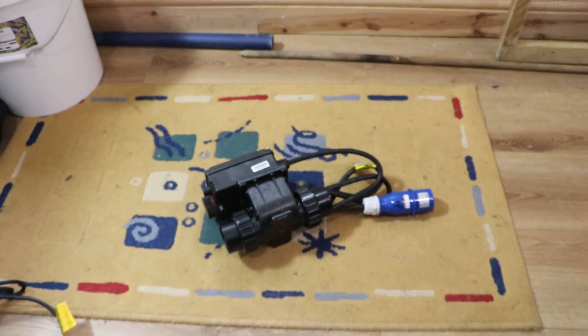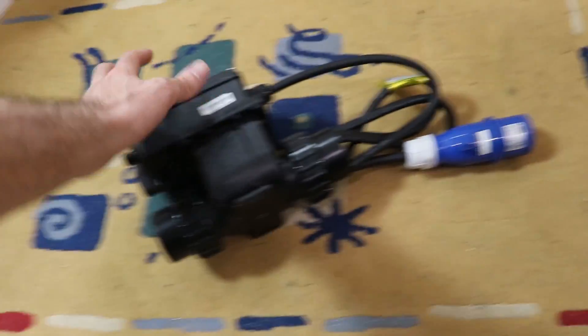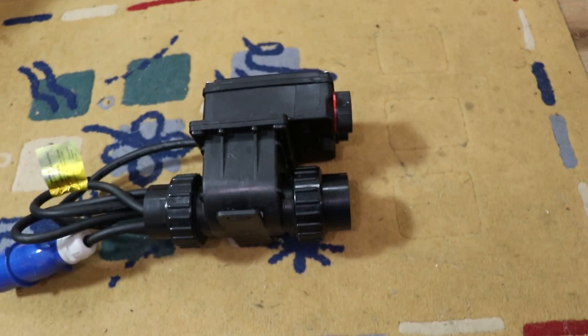It's a pretty good little heater. The only issue I have with these heaters is that they don't have any indication that they've got power to them or that they're on. I mean I could just drill a hole in it and wire up some LEDs so that you could see it's got power or that the heating element's actually turned on. If it were outside and I were trying to keep the pond from freezing, it'd be nice to have a visual indication that your heater's not going to fail you - because it could have tripped out the fuse and not be running.